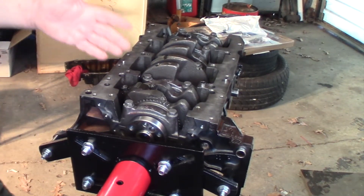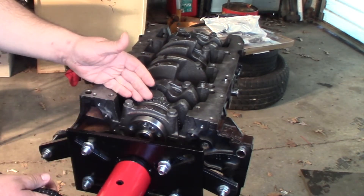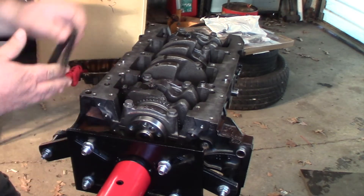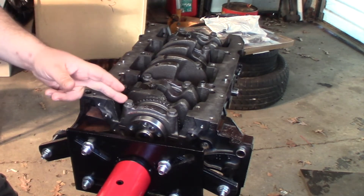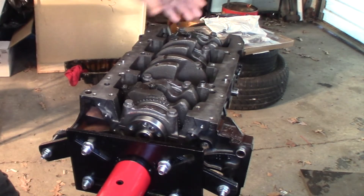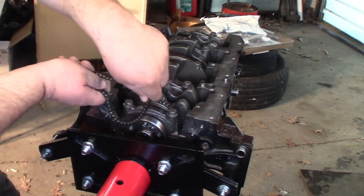I'll show you what we're going to do. I covered this briefly in a garage update a little bit ago, but I'm going to cover what we're going to be doing here to get this chain in place. For those who didn't see my garage update — the problem is I have this chain here that needs to go around this sprocket on the crankshaft, and this drives the balance shaft assembly. This chain should have gone on before I dropped the crank in, but I didn't do that. So rather than taking the whole engine back apart and pulling all the pistons, I'm going to take main cap number five off completely at the back of the engine, then loosen the others and let this crank down a little bit, then slip the chain in around that crank.